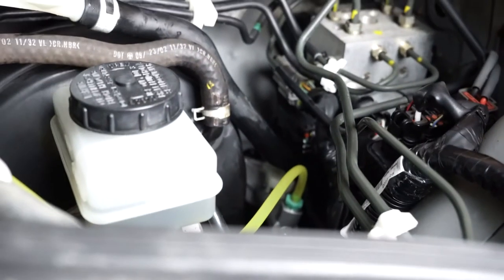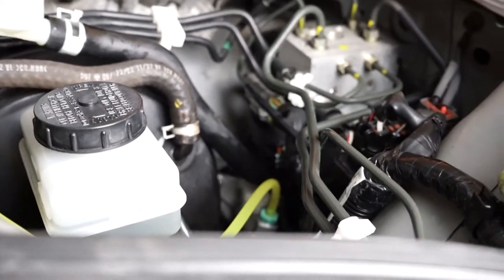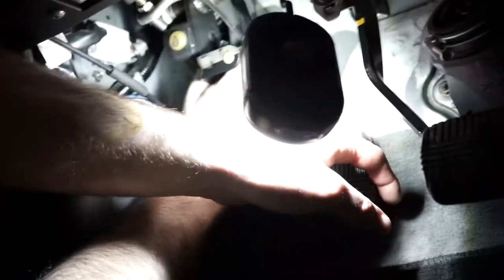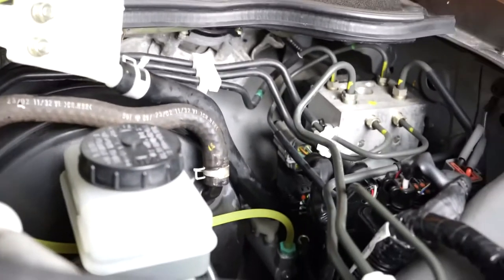Now I'm going to go in the car and go ahead and get the fork around the pedal so I don't have to worry about that later. I was making sure that the clutch pedal was inside of it, because there's usually not enough room if you get it on one side or the other once you get in the firewall without unbolting it and pulling it all back.